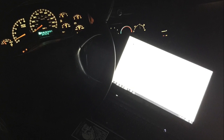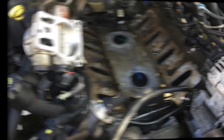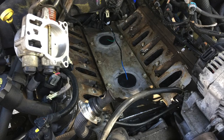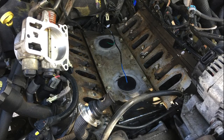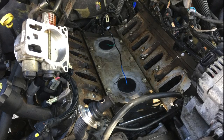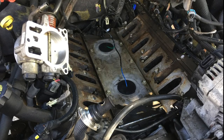This has been my opportunity to start learning HP Tuners, so I busted it out and started playing as soon as I could. I'm barely scratching the surface, but it's been fun so far. The truck was throwing a code for a knock sensor. A knock sensor will pull timing, but it was actually a false knock — common on these vehicles. They get water around the knock sensors, they start corroding and sending a false signal. We can't have the lost power from timing being pulled, so I put in new knock sensors, a new knock sensor harness, and cleaned up the throttle body.